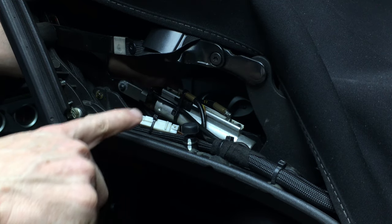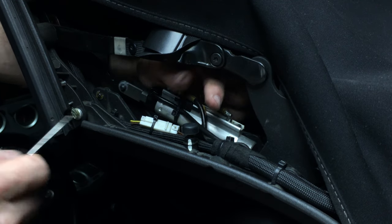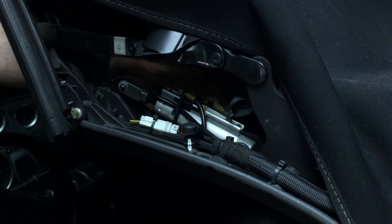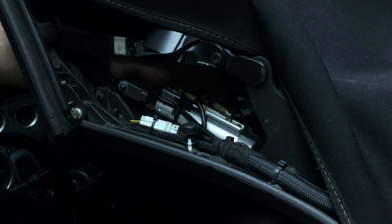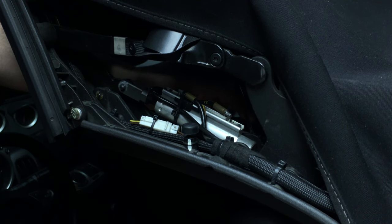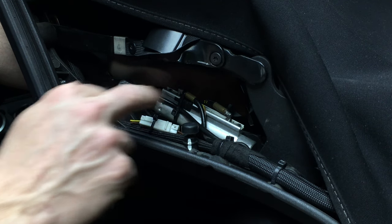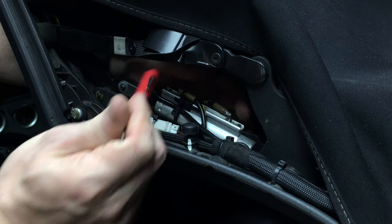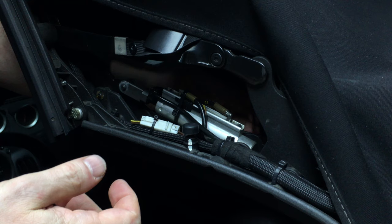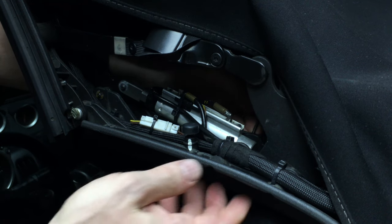On the rear pin, the circlip is on the inside — kind of hard to get that on camera right now — but if you were to kneel in your driver's seat, you would see that you can just push this pin circlip up the same way we did it on this side. We've taken it out already, now we can push this pin out of the way.